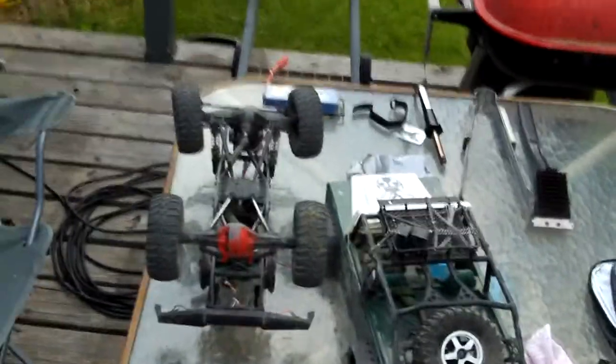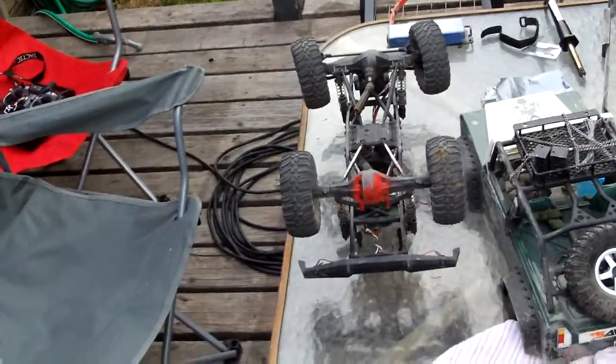See how it's sticking out? It's backed out, definitely. I can see lots of thread on that. That can go back in. See the other side? It's flush. That side's flush. That's the side I need to take out. But the rear is starting to work its way out, so we're just gonna go ahead and take it off and re-tighten the drive shaft to the yoke, and then just do it for both the front and the rear. Just as preventative maintenance there. You know, one side comes off, you really don't want the other side happening right after.